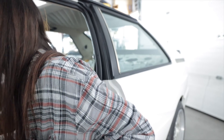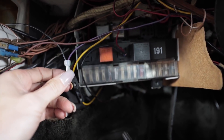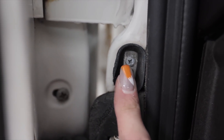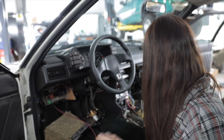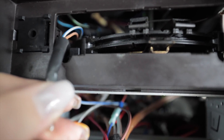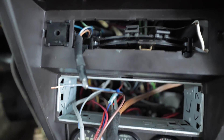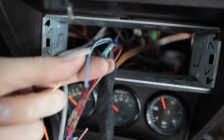I need to figure out which wire they had hooked up in here. The only wire that didn't really make sense behind this dash was this purple one — if you follow it, it goes to a black wire with a white stripe. Why do you have a wire hooked up to the switch for your door? I need a ground. Up here I've got a gray wire with a blue stripe and a brown wire, and that goes to the illumination for my climate control. Down below, these two were just wire-tied together.